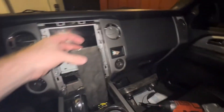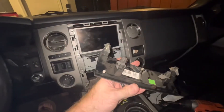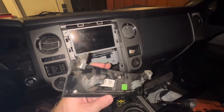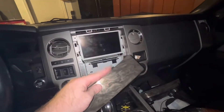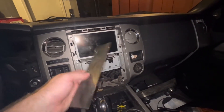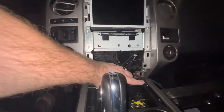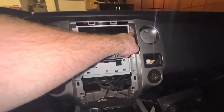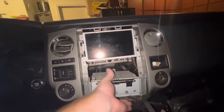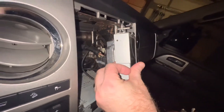The unit sits right here, and on the very bottom it sits in there slanted, hiding two screws underneath. The clips are kind of hard to get out — they pull straight out. I used something called a spudger tool; you could use anything plastic that won't wreck the finish. Once you get under there, there were two screws, and taking those out exposed the whole panel. Then there were six screws total — one, two, three, four, five, six — and then this unit slides out. On the back is the module we're talking about.